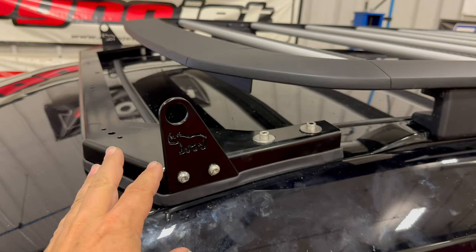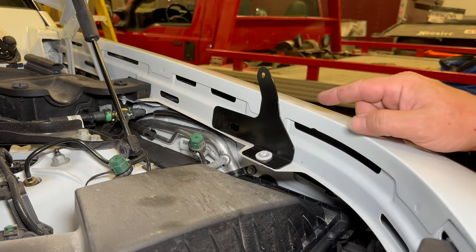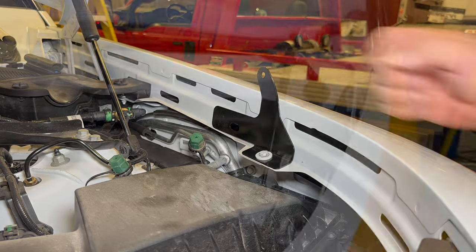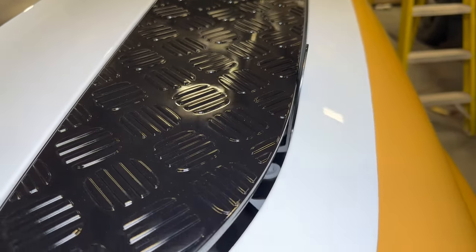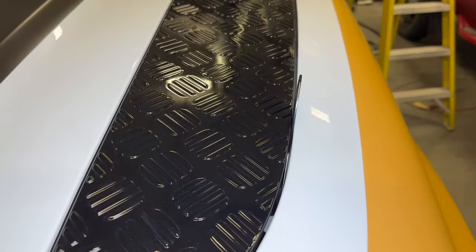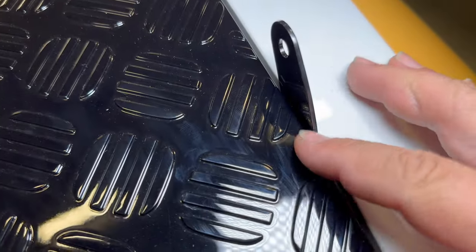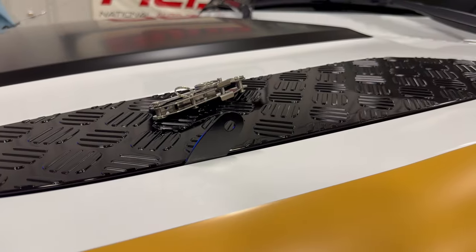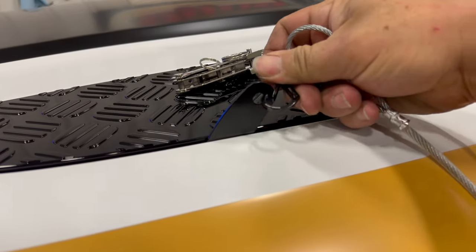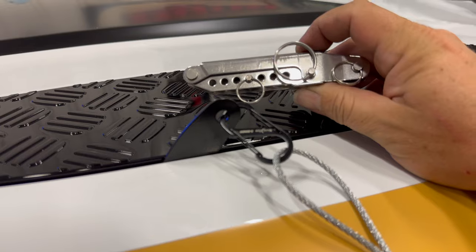Now that everything is good up top, let's put the lower mount on. This kit came with brackets that mount right here — there's a bolt I just need to take out and then bolt this in. I'll install the other side and then check that the bonnet clears. Bringing this down slowly — looks like there's plenty of room. It's not touching the bonnet at all. There is a gap right there so it's not going to rub. Now I'm going to clip the bottom of my limb riser here, then take the cable and tensioner up top and get this installed.